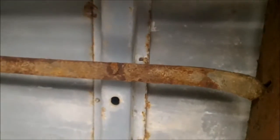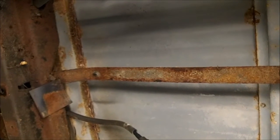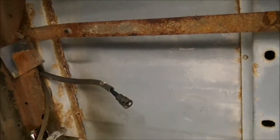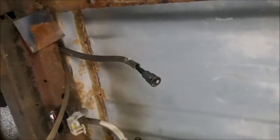The only bad thing about this design is that once you pull off the skid pans, there's no straps on the bottom holding the tank in — so the skid plates come off and the tank pulls out. You have to remove them all the way and drop the tank about a quarter of the way so you can get to the sending unit on top and unplug everything to get it out. It's not too heavy though. Took me about three hours to get this far, including about an hour for removing that one bolt.